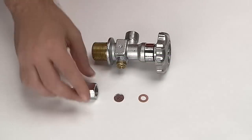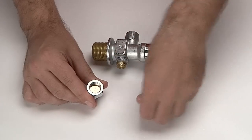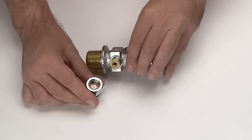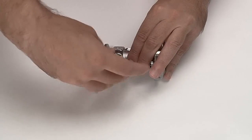The process is the same for an externally threaded safety port, with the exception that the burst disc is placed cup-side out followed by the included copper gasket with the grooves down into the port on the Zex Safety Blow-Off Fitting. The Safety Blow-Off Fitting is then threaded into the bottle valve's safety port.